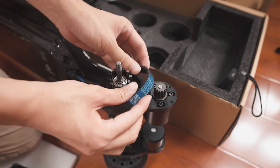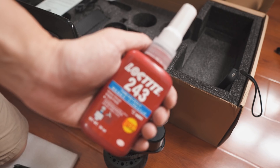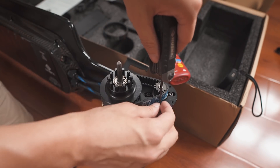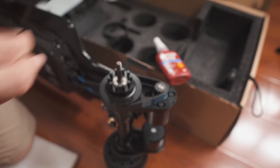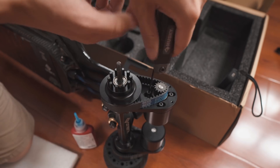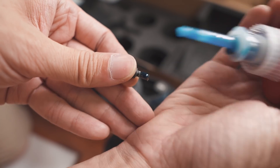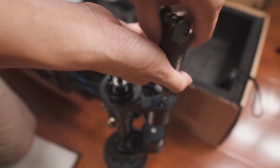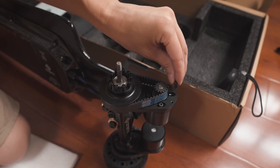It's really easy to remove the belt when it's at the proper tension. Tighten one screw first, because you want to apply Loctite to these screws so they don't fall out from all the vibration — I have another video about Loctite, linked in the top right and description. Take out the other three screws one by one, apply Loctite either on the screws or drip it into the screw hole — you don't need a lot, basically just one drip. Once you've applied Loctite to the other three screws and tightened them down, loosen the outermost screw that you tightened first and apply Loctite to that one also.